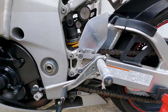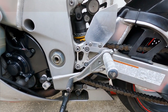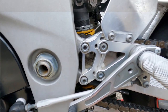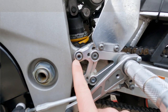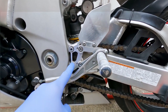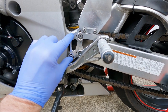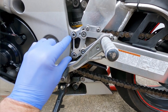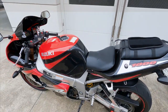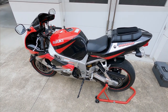The reason it's so uncomfortable is because I'm six foot three and these rear sets are extended as far as they can go. I didn't realize these are actually adapters to push them further back. So what I'm going to do is whip off the adapter and move the foot rests to a more forward and lower position, which should help.